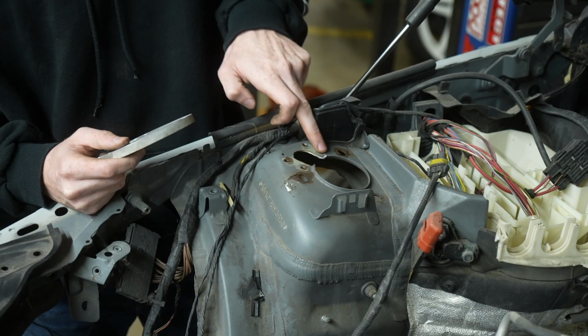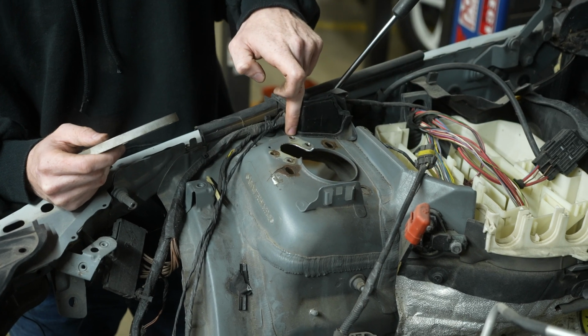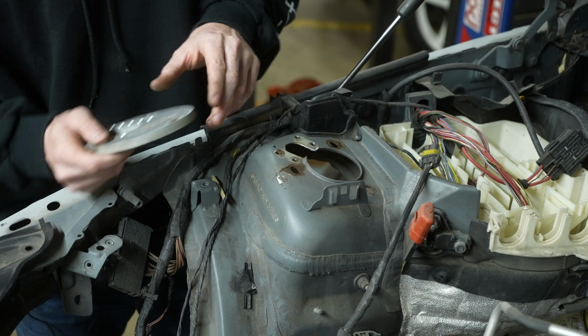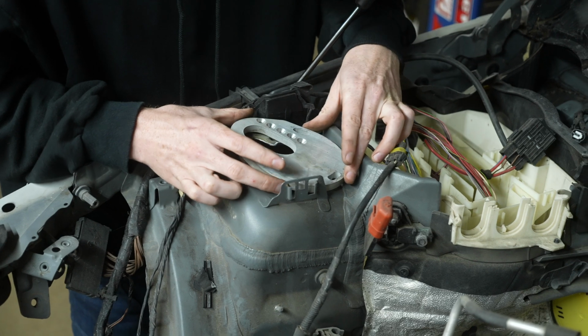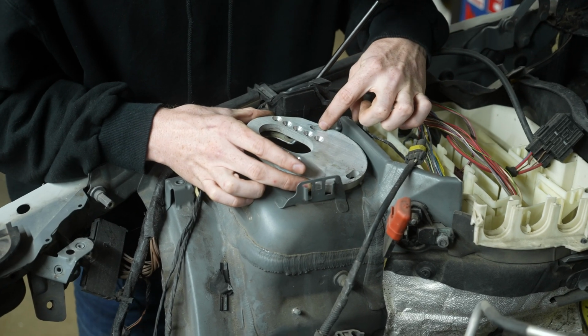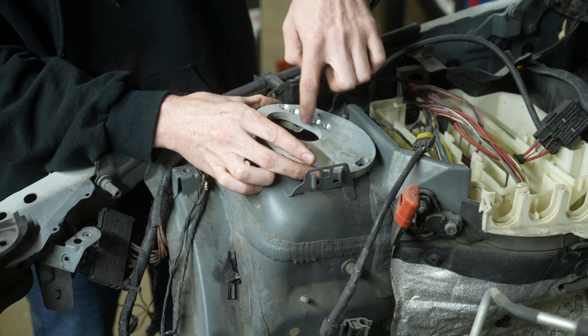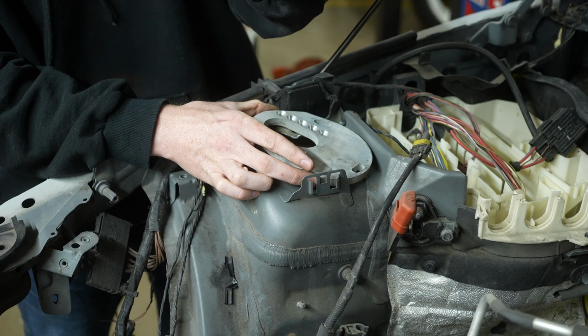So originally there was a mounting block here. This mounting block needs to be removed. You can simply just drill out the spot welds so that you have a flat surface here now. Then you're gonna take the plate and you're gonna line it up with the holes in the chassis and with the holes in the plate. This is gonna give you a nice area where you can clearly scribe with a marker where you need to cut. Marker, Kyle.